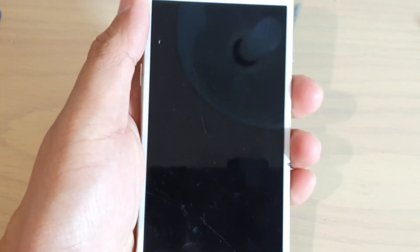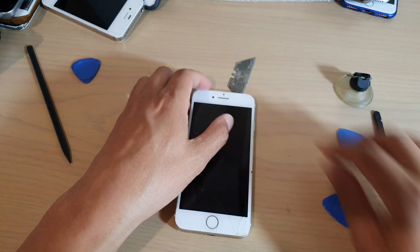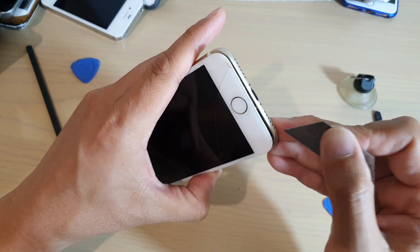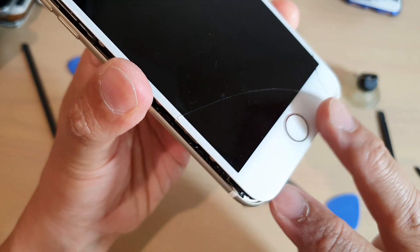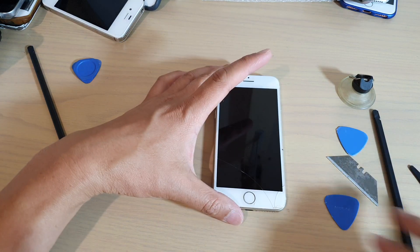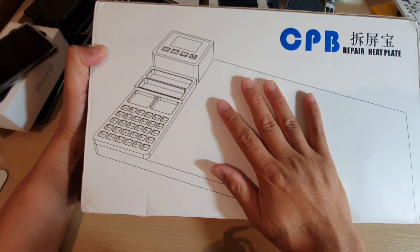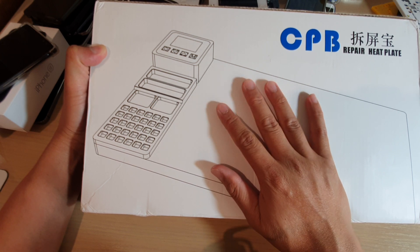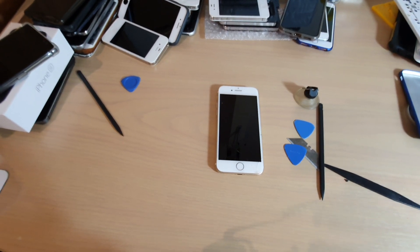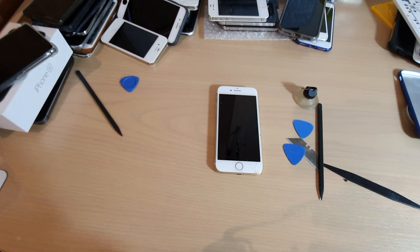That's how you can remove a difficult iPhone 7 screen. If you feel like it's stuck and it won't move, you just need to use a razor blade. The trick is the razor blade — you need to really get an opening at one of the corners, just push it down. Yes, it can cause a little tiny scratches but they're very tiny. Otherwise you may need to use a special tool — I have this CPB repair heat plate here. You can put your phone on this pad and it will provide the correct temperature to help you remove the screen easily. But if it's a one-time job, just use a razor blade to pry out the glass — that's the easiest way. Thank you for watching, please subscribe to my channel.